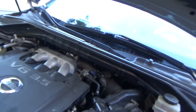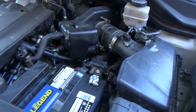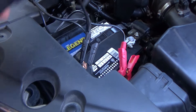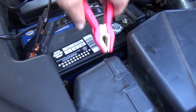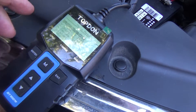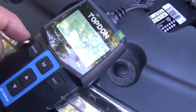I'm going to get my multimeter and put it across the battery posts to see what it shows. This tester was handier to grab, and it shows actual voltage, so I'm going to hook it up. We're reading 12.22 volts. It's got a battery test — brand new battery, so I'm sure it's going to be good. Let's go to the charging test.